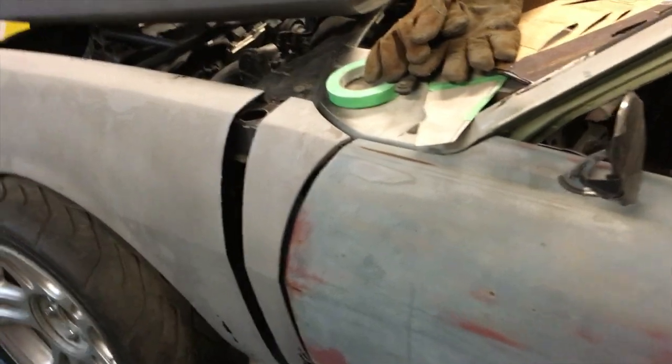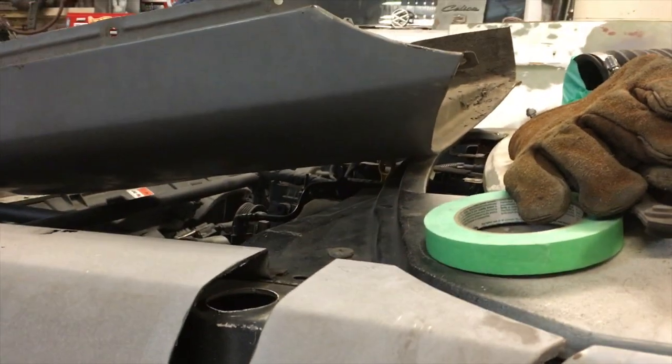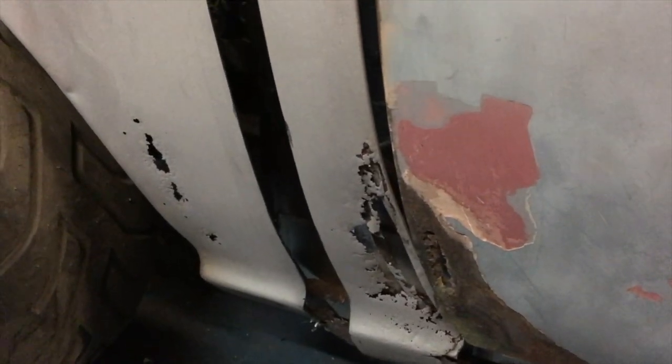This should make it a little more clear what I'm doing to the fender — the two-inch stretch. We'll be stealing material out of that fender and hopefully I've got enough to do both sides and rust repair. This fender is bare metal, so now we know exactly what's got to be repaired on it.